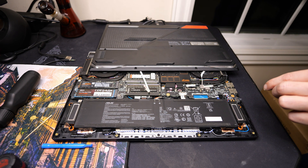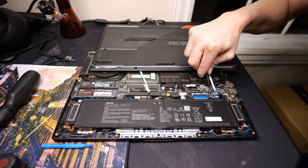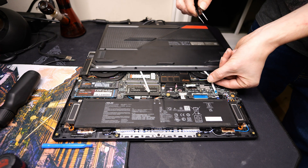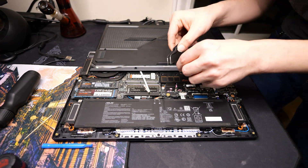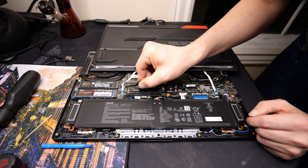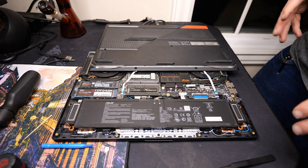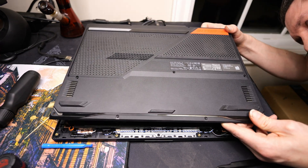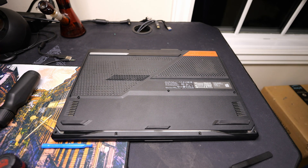Real quick before I put it back together, since I don't show this part very often, I figured I would show you guys how to reinstall these little connectors. All you're gonna want to do is take your tweezers, grab it like that to get it started, and make sure it's held completely straight, pushed in there. Drop that little guy down, give it a little tug — if he doesn't come back out, he's good. Do the same thing with this one. Give it a little teeny tiny tug, not too hard — you don't want to break it — just to make sure it's actually in all the way. Otherwise you'll put the thing all the way back together and it won't work; you won't have any RGB. Make sure none of the wires are gonna get into the fans, put your casing back on, crack it all on, put your screws back in, and you're good to go.